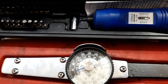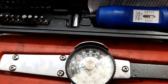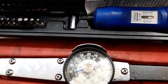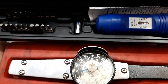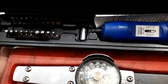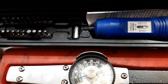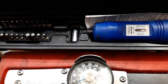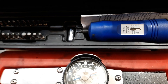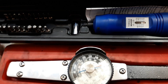The message here: torque to spec. Use the tool — don't be like the flat-rate guys who impact everything and call it good, only to find out it was over or under. Another example where I use torque wrenches a lot: DPF. Somebody will say they already replaced the DPF, and I'll put the torque wrench on the v-clamp, set it to 20-25 foot-pounds, and I'll give it between 5 to 15 turns before that thing finally torques. That's heat escaping.